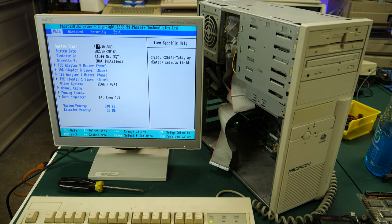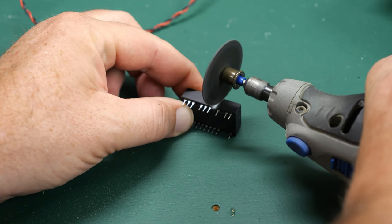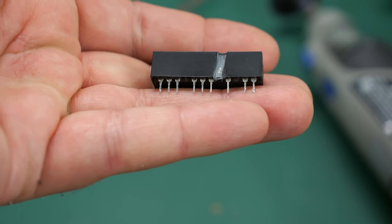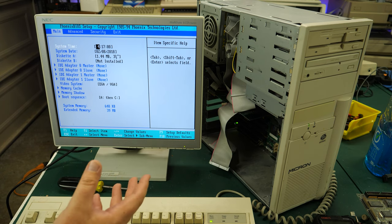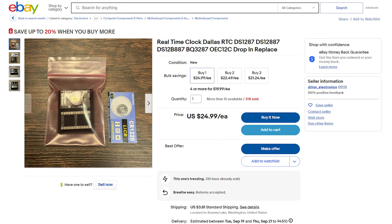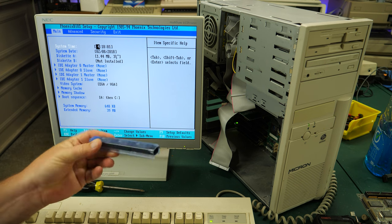In the past I've shown that you can fix those Dallas chips by adding a lithium battery to the top — you use a Dremel tool to scrape down the plastic and epoxy, get to the pins hidden underneath, attach wires to a battery, and resurrect it that way. There's also the Necroware replacement option, but the ones I found on eBay were like 30 bucks, which I thought was kind of ridiculous. So what I did was check if I could find brand-new replacements from places like Digikey.